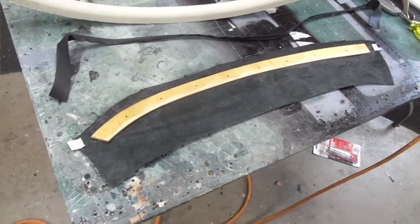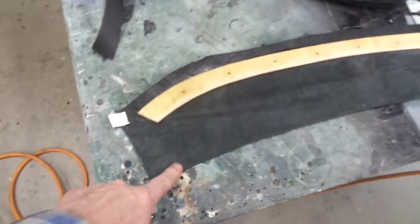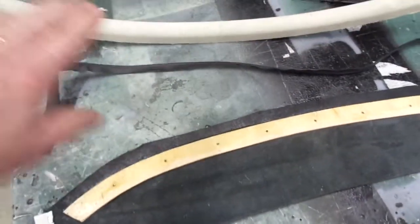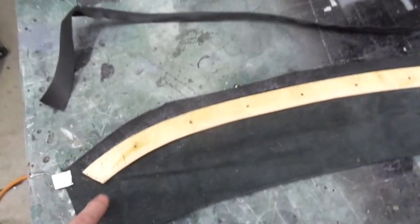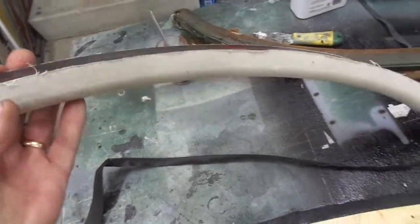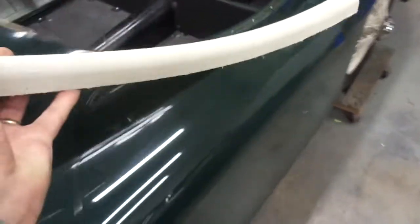This is the beginning of the left-hand side crash roll construction. I've taken this piece of leather and I've stretched it on this work table and stapled it down. You need to stretch it because there's a curvature that the leather's going to have to follow. If you don't stretch the leather ahead of time, it'll wrinkle, and the wrinkles are hard to get out. This is the D-roll with the linen cover glued on as it was originally. It's trimmed to fit precisely on the door, right here.